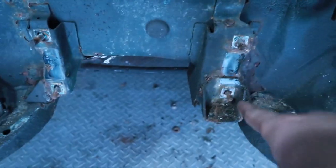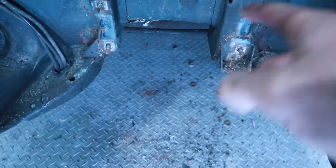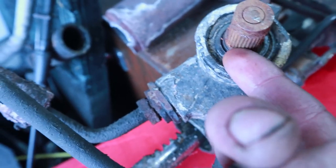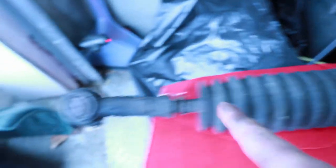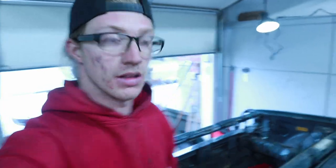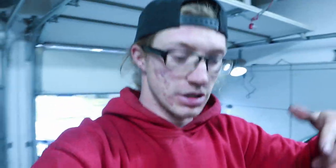After you remove the four nuts, the whole rack slides off those studs and you just tap it down and push it out. The whole thing comes out. You can see this is where it goes into the steering column, and all the hoses came out with it. The tie rod also came out with it — I'm going to keep it so I can match the size when I put it back together. So there you have it — that's how you remove a steering rack. Thank you guys for watching, see you next time.